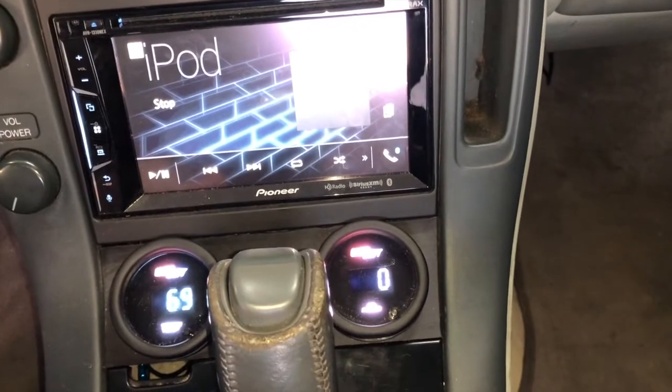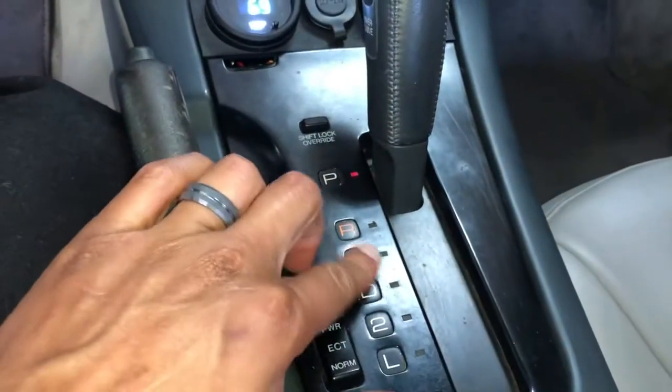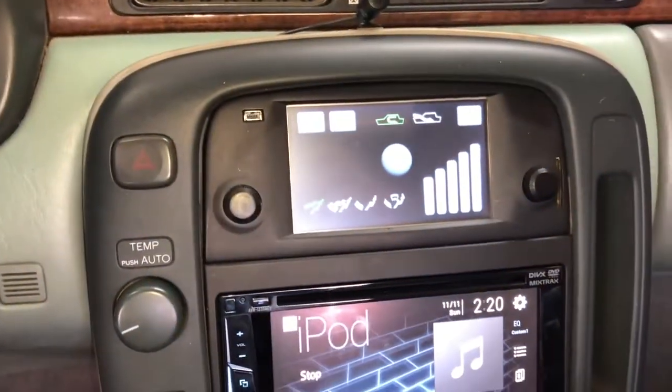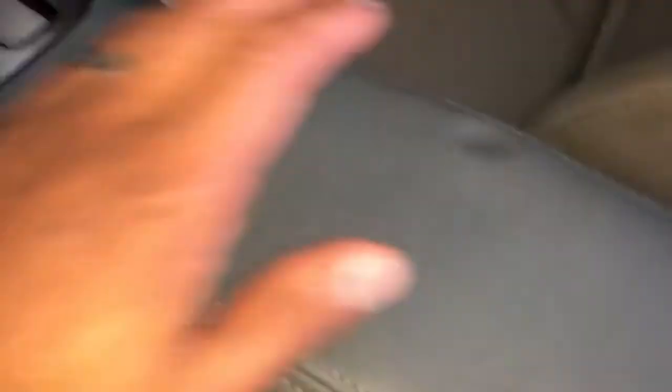You need to make sure the gauge and the sensor each have their own ground wire wired to the same ground so you don't run into that problem. Besides that, everything is going pretty good. There are a couple of bulbs I need to replace - the lights here don't light up, and the light behind the hazard doesn't light up either, but I've got bulbs on order. All in all, everything is coming together pretty good. Putting the armrest back on - pops right open.